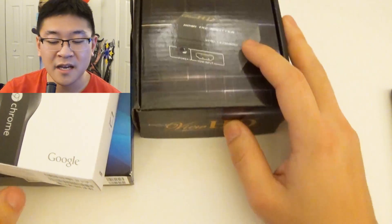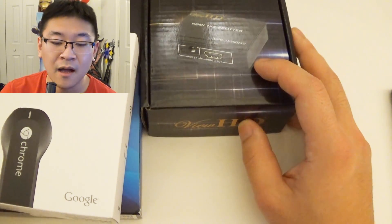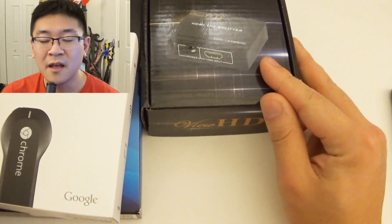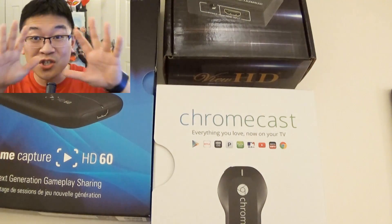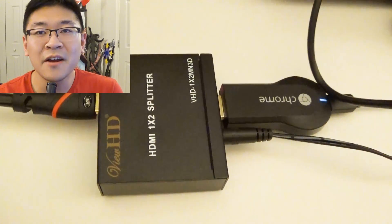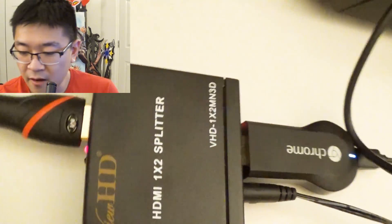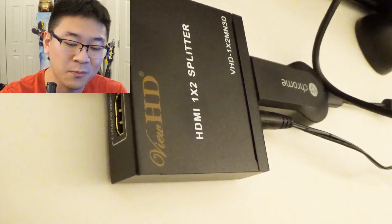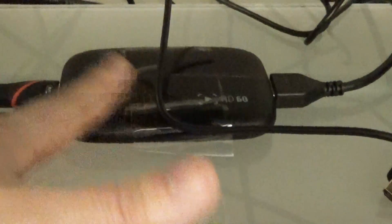Now, if you want to buy any of these items, I have a link in the description box as well as on my website LPX Studios to purchase them through Amazon.com and maybe Best Buy. By the time most of you see this video, both links should be up there. So what does the setup look like? I'm going to show you how I rigged it up here — excuse the layout, my room's a little messy. The Chromecast goes into the input side of the HD splitter, and on the output side I connect one HDMI cable to the input side of the Elgato Game Capture device. Then you connect this to the PC, install the software, and the output HDMI goes to your display.